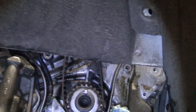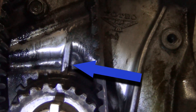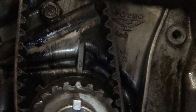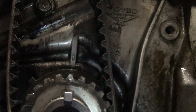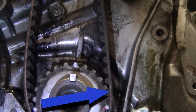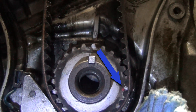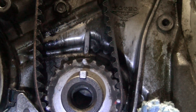Going past the brakes into the wheel well, you can see the crank pulley. There's an arrow cast into the oil pump that corresponds with the drive pulley — that's top dead center for number one, as well as whatever's on the opposite end of the firing stroke. The crankshaft moves two times for every one camshaft rotation, going from a two-stroke to a four-stroke cycle. Note the slack on the left side and the tautness on the right. The alignment key or woodruff key on the drive sprocket points up toward that same arrow. You may find other markings; I've re-tagged them all in white.